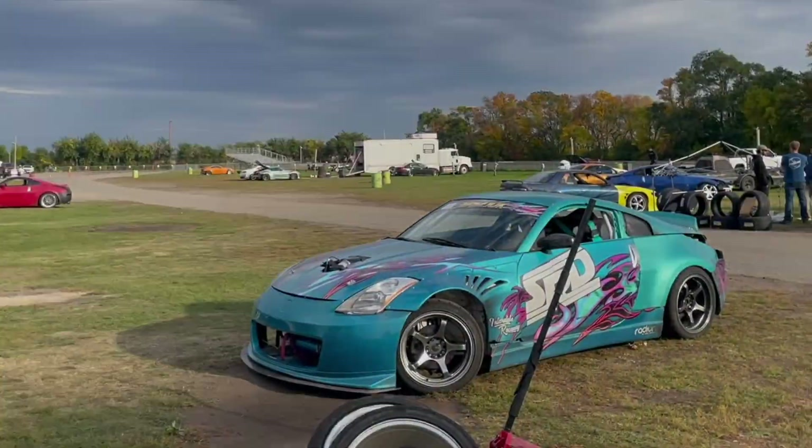During the process of getting this car together it was very hectic, very stressful — there's no information out there on doing this. Essentially, an Audi Quattro TT, at least in the first generation, isn't a true all-wheel drive system. There's a clutch pack in the rear. Right here is the actual differential — one axle goes in each side, the pinion gear goes through here, and this whole Haldex assembly houses the clutch pack.